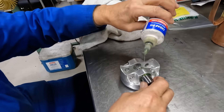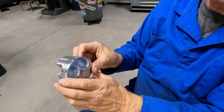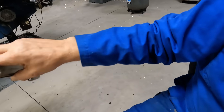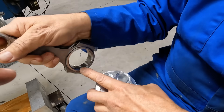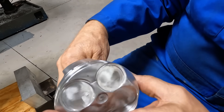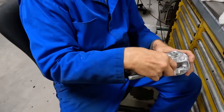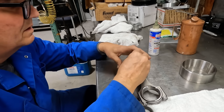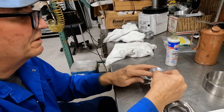This is just a slip fit with a little clip on the end. The key on these is you've got to make sure the chamfer goes in the right direction, because the chamfer has to be up against the radius in the crank. The chamfer is on the bearing on the big end — that's the most important thing. The intake is going to be down, and traditionally in a stock engine there's like an arrow or a dot for orientation on top of the piston, but race pistons are different.